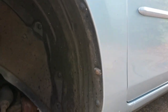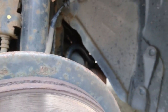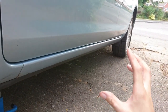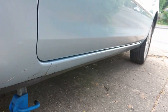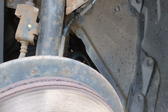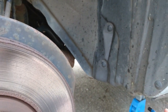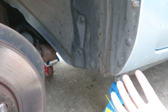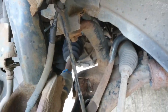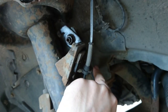Gary Dixon GTR back again, and today we're on the Mazda 3, tackling that clunking sound. Unlike a broken rear spring which gives a metallic rattle over bumps, this one is a clunking sound when you go over uneven ground — like where a layer of tarmac has come up — and it feels like a little knock at the bottom where your feet are in the car. If it's a clunking sound at the front, it's these right here.